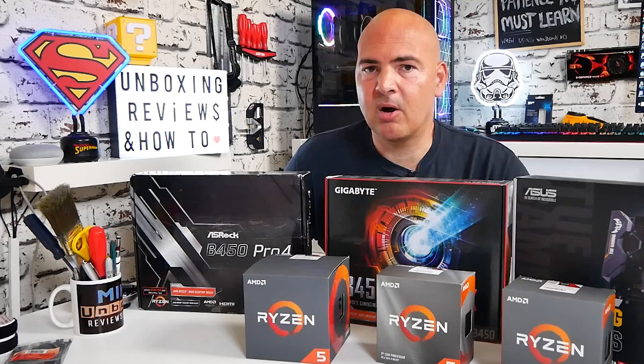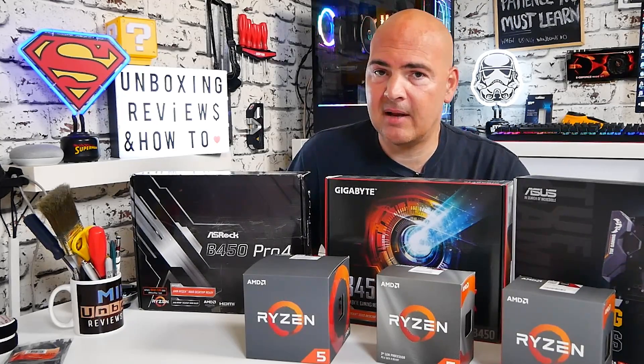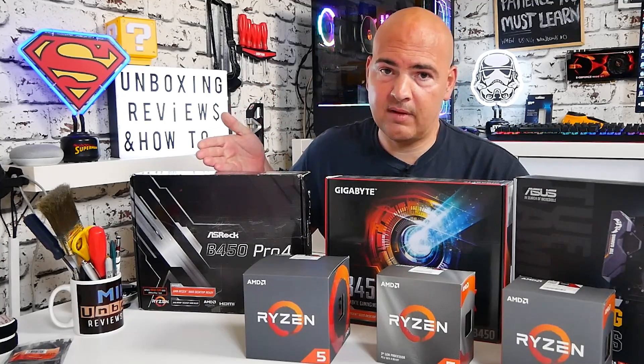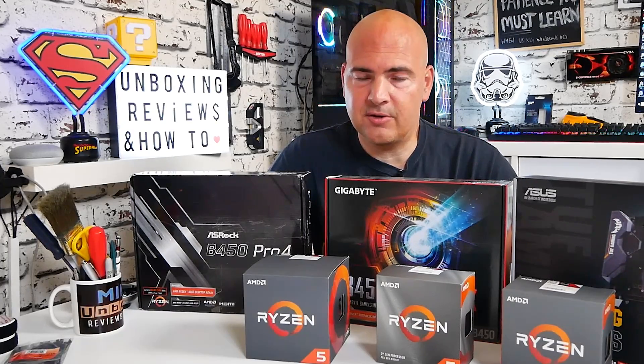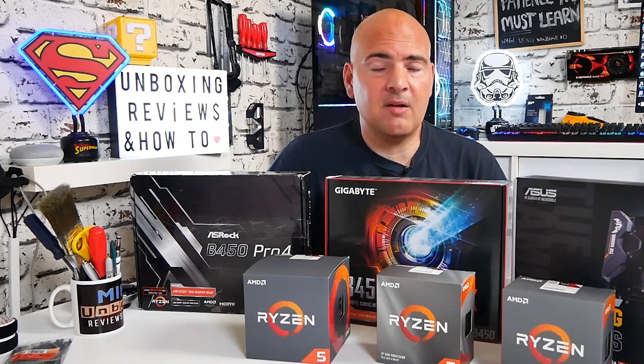Having said that, you might be better off investing money you'd spend on a cooler — maybe £20 or so — and actually upgrading to the next level of motherboard, the B450 chipset. The B450 was a replacement for the B350, and was released at a very competitive price, generally anywhere between £10 to £20 more than its A320 counterparts. Along with that, you get extra features, an unlocked BIOS, better feature sets, more slots, more fan headers, and all those kinds of things.